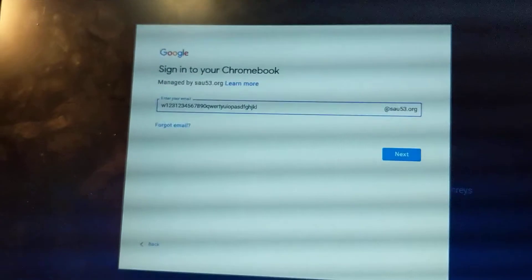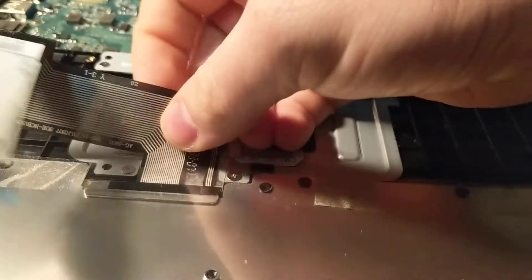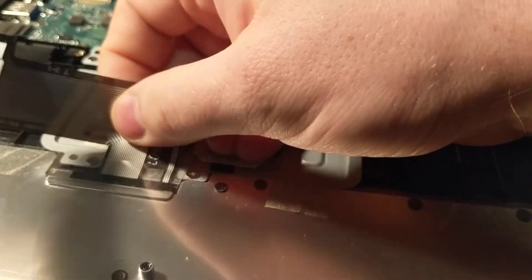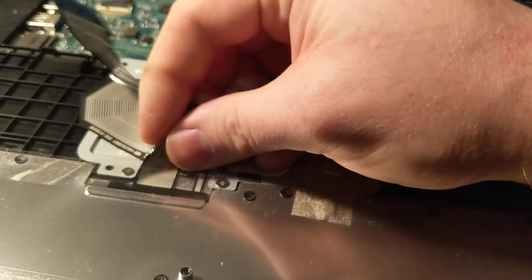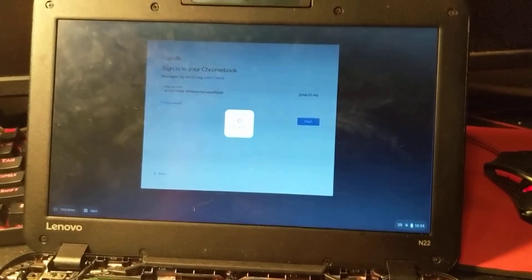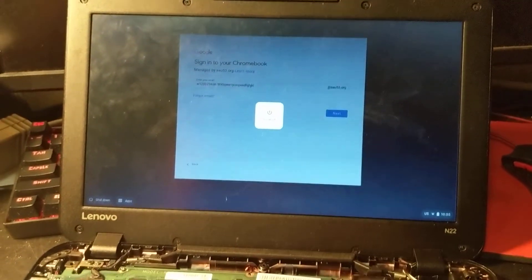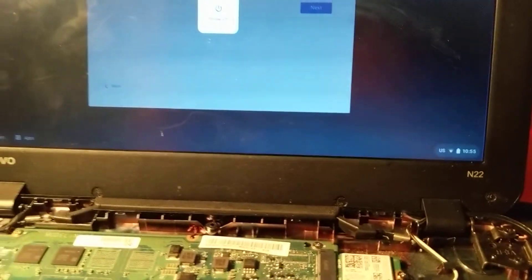You may also want to fiddle with the cable a little bit more. Sometimes the corrosion actually happens inside of the ribbon itself, so you may just want to take the ribbon and kind of lightly pull on it from the side with the keyboard, give it a gentle little knock back and forth, kind of wrinkle it up a little bit — I find that in most cases that does the trick. Hopefully this helps someone out there who's having trouble, and you don't have to spend a fortune replacing your entire fleet of keyboards. Hope that helps. Bye.